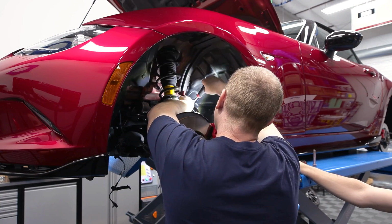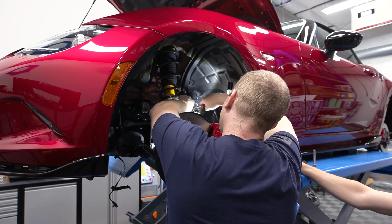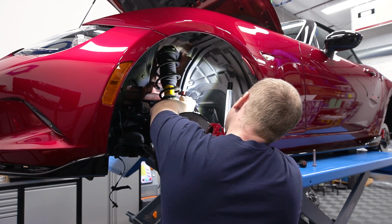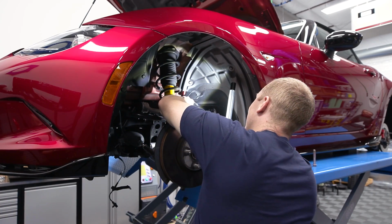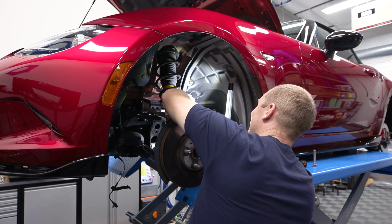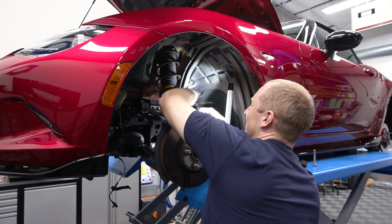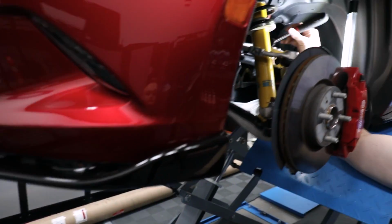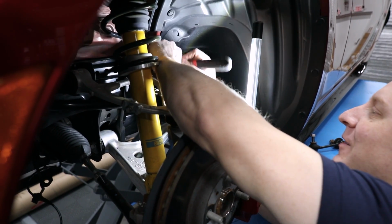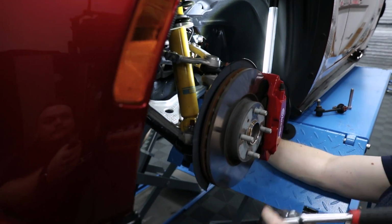So they used a wobble socket on there, but I didn't really see one in the drawer. Oh yeah, that's the problem. Look, I'm gonna get this off of here. Good call. Shoot. I didn't think that one through. See that, Mike? In here, the brake line is in the way. So you can get it on there, but you can't get it off. Just give me 17 ratcheting.